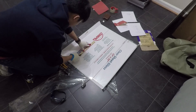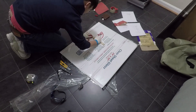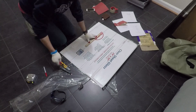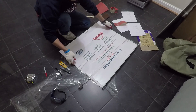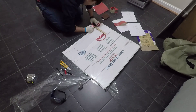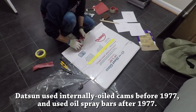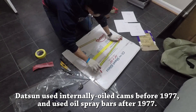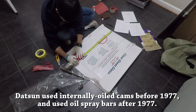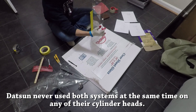Other than pure curiosity, the biggest reason why we're doing this is to visually verify that the camshaft is getting oiled properly on all lobes. Of course this is very critical to ensure the longevity of the engine. My camshaft is actually getting oiled in two different ways. The camshaft itself is an internally oiled unit, so at the tip of each camshaft lobe there is a hole that pushes out oil constantly to keep the lobe lubed when it's getting pushed against the rocker arm.